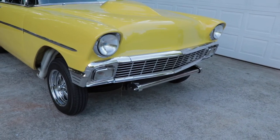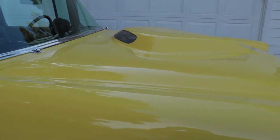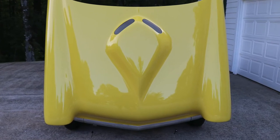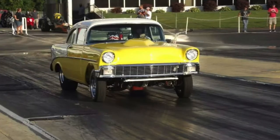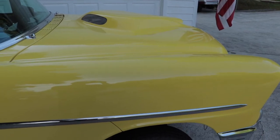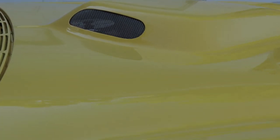The rest of the front is pretty standard, except for the Thunderbolt hood scoop that I've grafted onto the hood — and when I open the hood, you're going to understand why I needed that clearance. The Thunderbolt hood scoop, typically associated with Ford cars, really fits the vibe of the car and was pretty common back in the day. It helps expel a lot of heat, and at the drag strip I get a lot of air under the front. The steering does get light at around 120 miles an hour. The Thunderbolt hood scoop, with the screens in the back of it, helps expel air underneath the hood as well as engine heat.